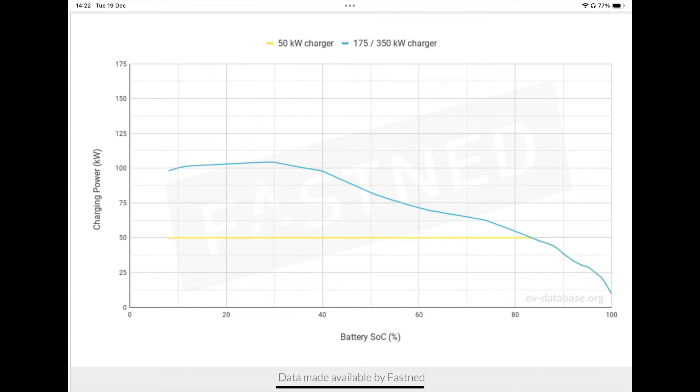With all electric vehicles it does depend on the temperature of your batteries. If your battery is at the optimum temperature — around 21 degrees, similar to us really — then you should expect to see the fastest speeds at the beginning of the charge. You also need to take into account the charging curve. On the Jaguar I-PACE, it starts at peak 104 kilowatts at the very beginning, around 10 to 40 percent. As you start to get towards 50 percent, it starts to drop down, and by the time you get to 80 percent you'll see speeds of 50 kilowatts or below. After 80 percent, it really starts to slow down.